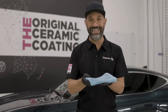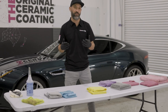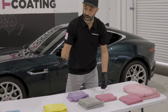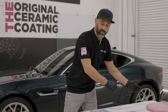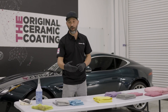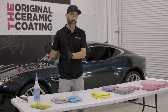This is the type of towel we would use for cleaning an interior of the vehicle. Simply put, it's just not good for paint, that's why we use it on the interior. Let's go through a recap: GSM is grams per square meter — the higher the GSM, the more quality the towel, and those are the towels you typically want to use on paint. You'll also find that most of them will have a laser cut edge, not a wound sewn edge, because the wound sewn edge can actually scratch paint. So use your high GSM towels for paint, and your low GSM thin towels with sewn edges for cleaning areas that are already dirty, because the last thing you want is to cross-contaminate. That brings me to one last important ingredient: color. When you really want to achieve a professional result, having multiple colors will help you keep your towels pure, so that you know exactly what you're using and when.